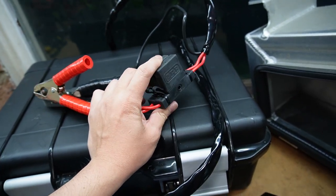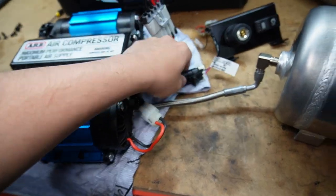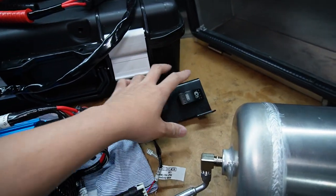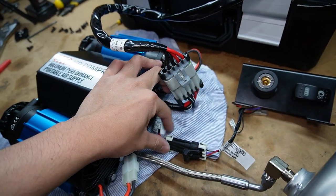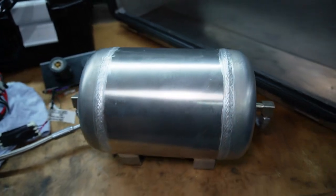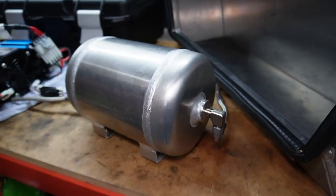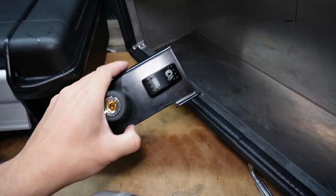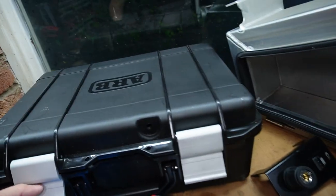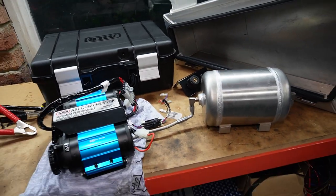The harness goes through two 40-amp maxi fuses to alligator clamps that connect to your battery. The compressor is controlled through a plug into the back of this ARB toggle switch — really neat, I like having these plugs, it makes the wiring a whole lot neater. When the compressor is on it pumps air into this ARB four-liter air tank. There's a pressure switch on the compressor that shuts it off when the tank reaches a certain pressure. From the tank, air runs through a hose to the outlet — you can attach a tire inflator or the included compressed air gun.